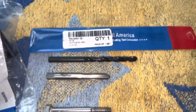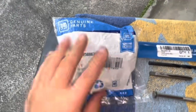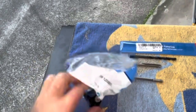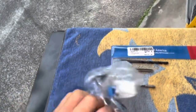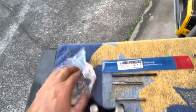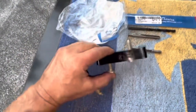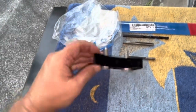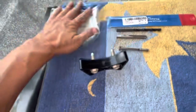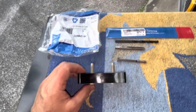Here's the tools and parts you'll need: a drill bit tap kit and the timing damper. A bunch of different companies sell this, but here are your bolts that go through — they're pretty long. So when you're drilling, you have to be sure that you're not going to go all the way through the block.